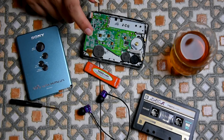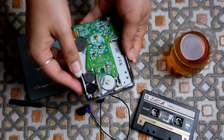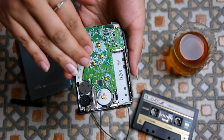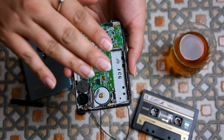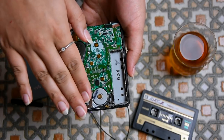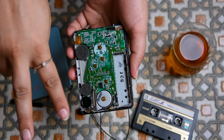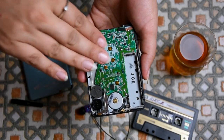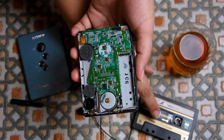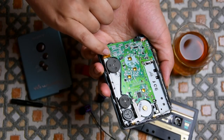I've taken it out again because I think I'm going to need to do some soldering. When I came back from the Play Expo, on the way there it was fine, but on the way back this actually has an auto-reverse, and on one of the sides — the right channel — it doesn't work. But when you flip to the other side of the cassette, both channels work. However, turn the cassette around and you get the same thing. It's not the cassette — it does this with all cassettes.